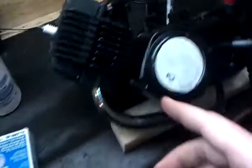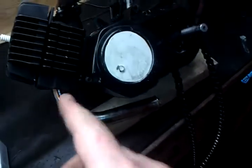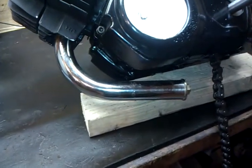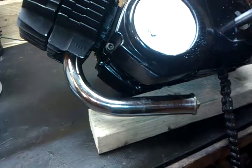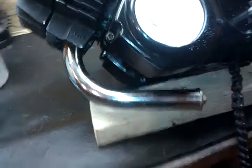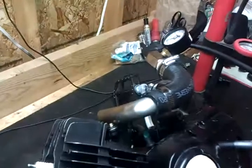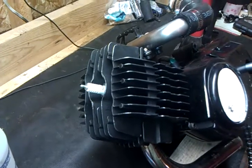I got a piece of radiator hose to hook it to the intake. We also want to block the exhaust, so I had a spare exhaust header for a Puch, which fits on my Tomos just the same. On the end I've got a little rubber expansion plug, so the exhaust is all sealed up. The intake's got that piece on there, and the spark plug's in there.